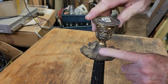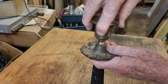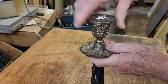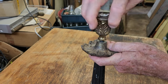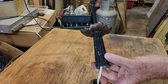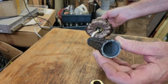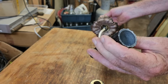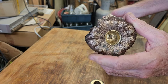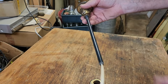and straighten it up. Now, even though that looks like brass, it's quite often just a die-cast zinc, and it's just been either plated or even just painted. We're going to have the cord twist around inside, but let's take it apart. We've got to put a new cord in it anyway. Oh, there we go. The whole lot's coming out. That's okay. So you can see that's a dark grey. It's quite heavy. It's not cast aluminium. It's certainly a cast zinc. They weren't made with great quality in mind, but so that bit's not damaged. But they do the job.